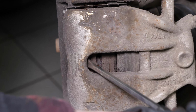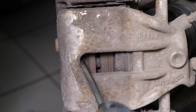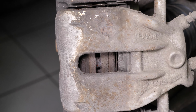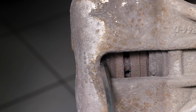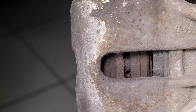Insert a flathead screwdriver to the outer extremity of the oblong hole located on the back of the brake caliper. Lift it off using the screwdriver as a lever by pulling it towards you. This will then push the piston in. Don't hesitate to push the screwdriver further in once the space between the pad and the caliper allows. Ensure that you have pushed the piston in as far as possible before moving on to the next operation.